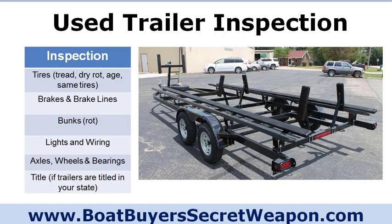For a used trailer — or a used pontoon sitting on a trailer — you want to do some inspections. On a new trailer, it's simple: give them the weight and length of your boat, the type, and the options you want. For a used trailer, check the tires — trailer tires can go bad over time with dry rot, age, or worn tread that can cause a blowout. Also make sure that on a dual axle, all four tires are the same so they run straight and proper. Check brakes and brake lines — not only that it has brakes, but that the brakes are actually engaging and working, and that no brake line is rusted, cut, or malfunctioning.